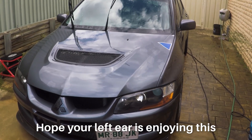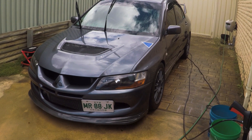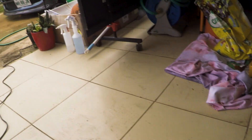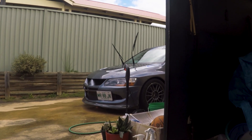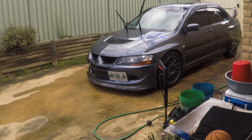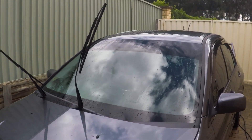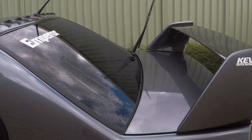My camera died so I'm filming on a GoPro now. We finished the contact wash and the rinse. Next thing we want to do is iron remover, and then after that we'll do a clay bar. This stuff — iron remover — it stinks, but once you spray it on it will dissolve the embedded iron particles you get from exhaust fumes and stuff like that. It's supposed to bleed purple. I've never done my car with it yet actually, so I'm not sure how much iron there is in it. I'll spray it on and see what happens, then rinse off and do the clay bar.